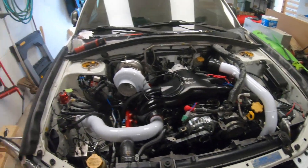It'll be a little more challenging to bleed, but there's nowhere to mount a reservoir and I don't want to crowd up the engine bay any more than necessary. This car's got a lot of stuff — it is a fully functioning stock car with air conditioning, Apple CarPlay, heated seats, everything. But it's also got three fuel pumps, a nitrous wet system, and a bunch of other things you wouldn't normally have in a car. We're limited on outputs from the Haltech Elite ECU without going with a PDM and digital dash, and we have limited room in the engine bay. The goal is to make it the most practical four-digit horsepower Subaru you can make — practical in quotes.